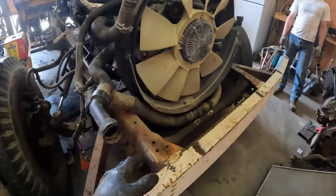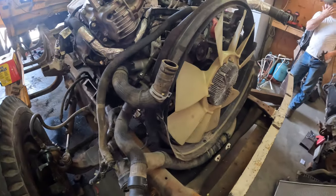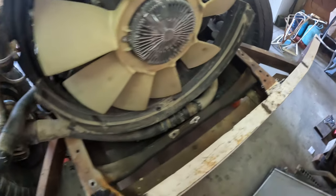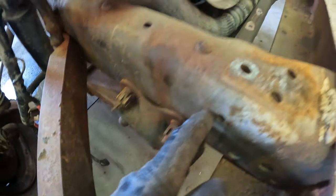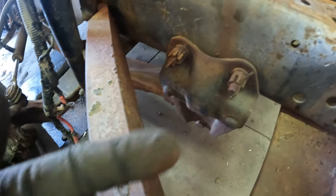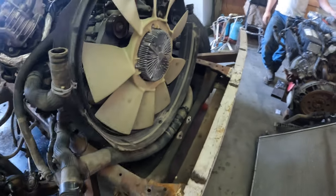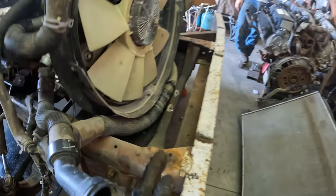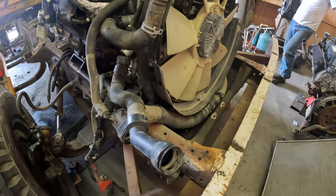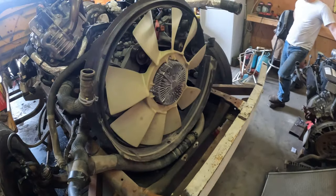So we just put the coolant system up and we're about three to four inches too high relative to the motor. What we're actually going to do is cut into the frame — this is where the front support is for the frame and we can't move it further back because that's where your spring mounts are. So we're going to come right next to it, cut it all the way up and around, do the same thing on the other side, and we feel like that'll give us adequate enough space to drop the coolant system down into place. We'll have to build a custom mount underneath, but we've already done that twice on the engine and transmission, so there's nothing to it but to do it.